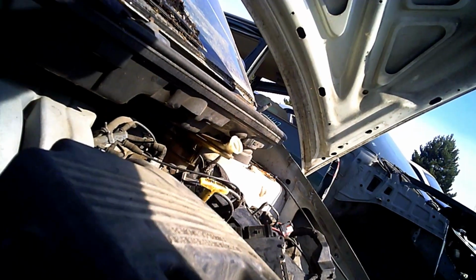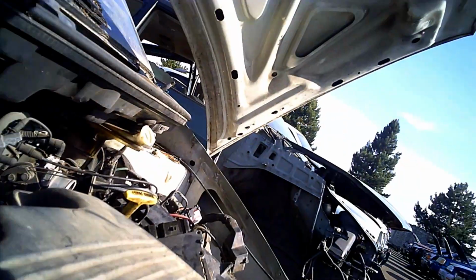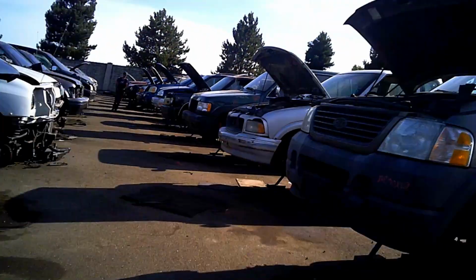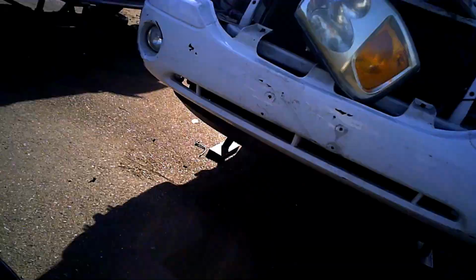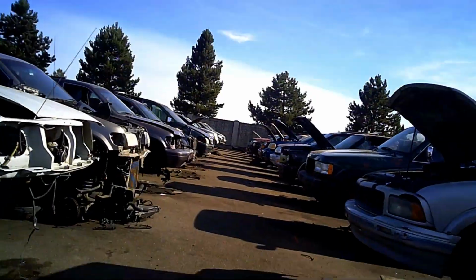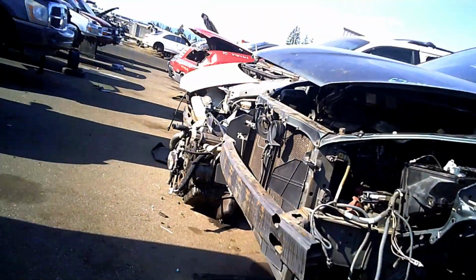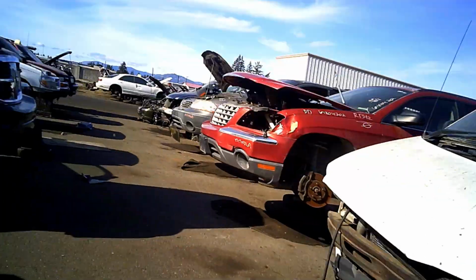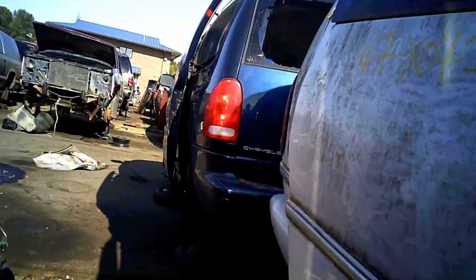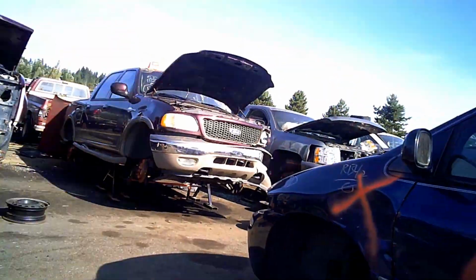Not the same. Hey, there's a coil box. Nope. Doesn't have a kit. Not what I was looking for. Because of the 3.8. Not that the spindle wouldn't work, but they didn't need a kit on the 3.8s because they didn't have this motor mount issue like the 3.3s did. Almost always it's 3.3s that have the kit. In other words, the double-sided V belt and the V idler pulley because it kept slipping off.